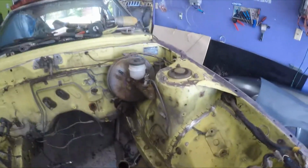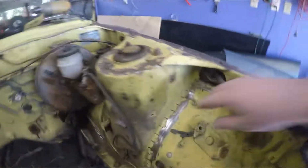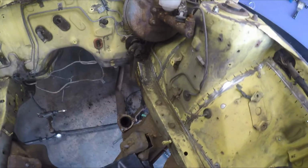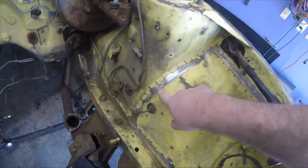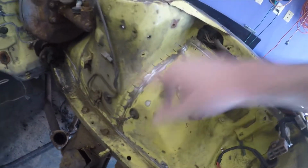One of the tips I'll give to you guys: the best thing to do is cut up a 1-inch square piece of cardboard, and then you move that cardboard around the seam and mark it on the edges, and you get pretty precise markings, so you give yourself some guide marks. Obviously you don't want to put the mark right across where you're going to be welding, because the marker will cause contamination in your weld if the ink is actually there.